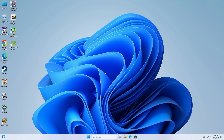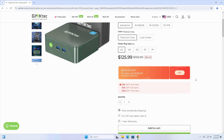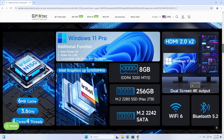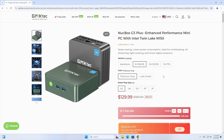When going to that performance setting from the BIOS, it also swaps out the fan curve for a more aggressive curve so we don't hit thermal throttle at 15 watts — but it's still a very quiet unit. This is about three feet away from me and I can't hear it spinning up. The N150 isn't a super powerful chip — it's not going to do AAA games at full speed natively, but it's great for web browsing, video playback, email, and document editing. Over at GMK Tech's website everything loads up quickly. The bare bones is $125, and the 8-gig model is $129.